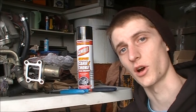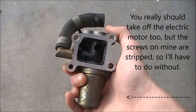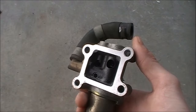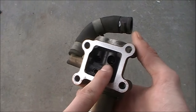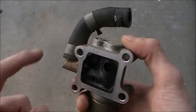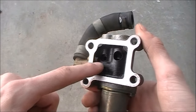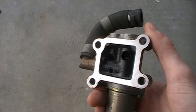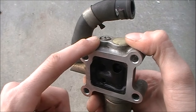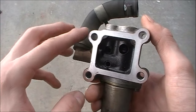Now that we got it off, we're going to use the carb cleaner and clean it out. We've got our idle air control valve out. Now what we don't want to do is just half-ass the cleaning so that we're going to have to come back and do it again later. A couple tips: in this hole, make sure that you spray off the spring really well — the spring is what returns the guide after the idle is over. And this is the adjuster screw to adjust the idle; that moves a bar in and out in this hole, which is going to allow a little bit more or a little less air in. So we're going to take this adjuster screw all the way out since it's one of the few moving parts on here that we can clean, and make sure that we clean inside all of these holes and crevices really, really well.